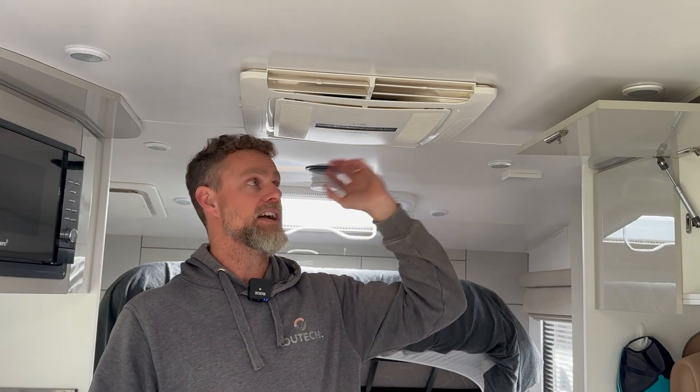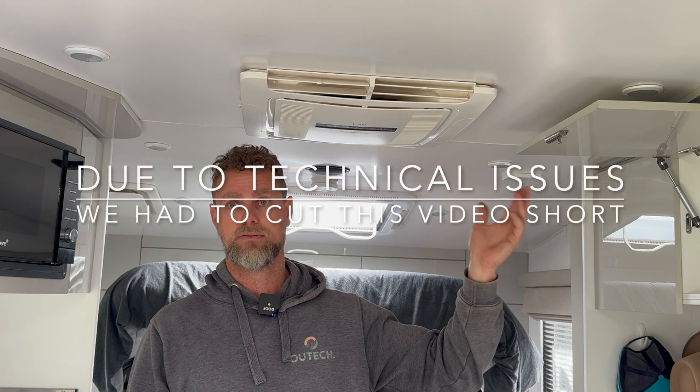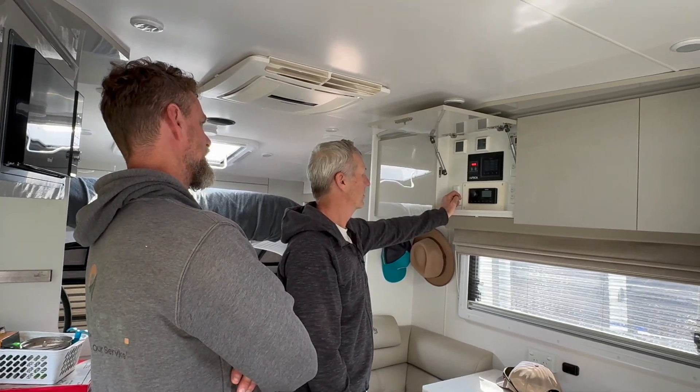The system is distributed throughout the van and we're actually running the air conditioner at the moment. It's been running for a week in the middle of spring at 18 degrees, so it's working really hard. At 9:30 in the morning we're sitting at 68% in the battery — that's been utilized over the last week running 24/7. The battery gets back up to full and then discharges overnight. We've also got the compressor fridge running. This system really does have the capacity to keep up with an air conditioner. At the moment it's saying at this rate we're going to take 2 hours and 10 minutes to be full.